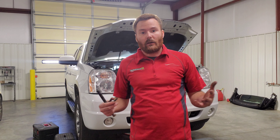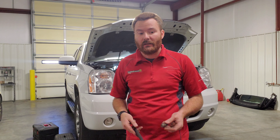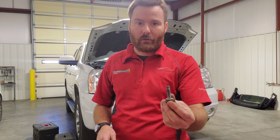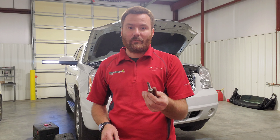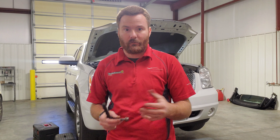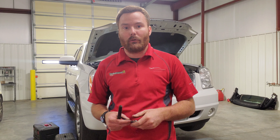In real time that took about 25 minutes to get all three top bolts out — they were pretty rusted in there. I had to soak them in PB Blast and let them sit, and the car being warm helped everything soak in. Now we're going to the bottom side where I'll show you the four 15 millimeter bolts you have to pull out down there.